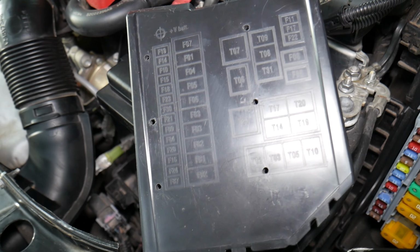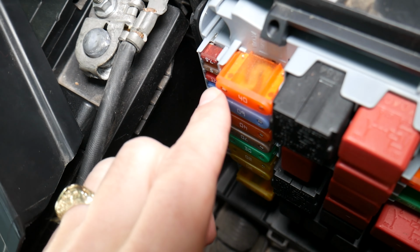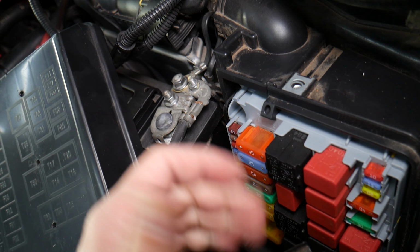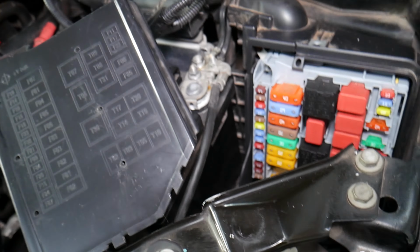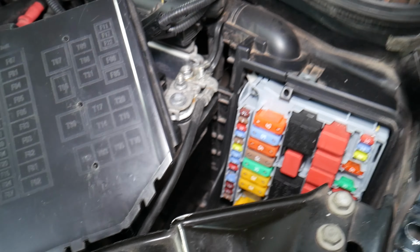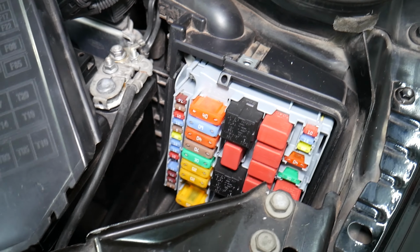So now, why it's a good idea to always test the fuse. If you look at the fuse or remove it, you may think it's a good fuse and you put it back in, but it's actually a bad fuse, guys. You may end up spending so much time and money to fix your problem. All we had to do is test the fuse. I'll put a link to a special video in the description below that explains how to test the car fuse in just a few minutes, and you will be able to find out if it's good or bad.